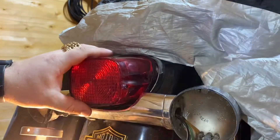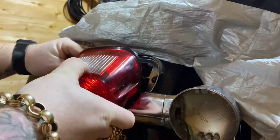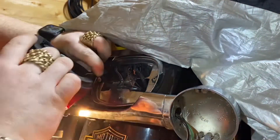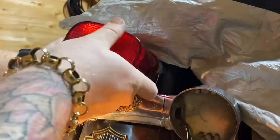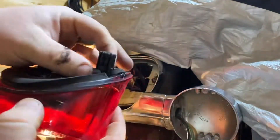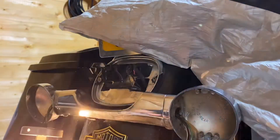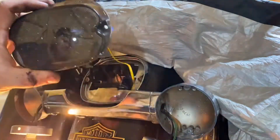So yeah, we're gonna start — there are two Phillips heads either side. I've already took them out, but either side you've got two Phillips heads. We're gonna drop the light out, then there's this connector here — there's a pushing part on the bottom, so just push that in and pull it out, the light comes out.